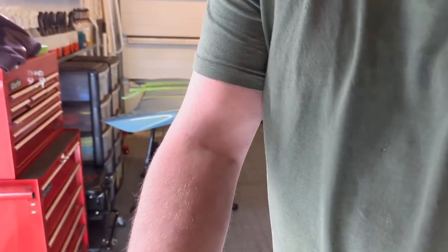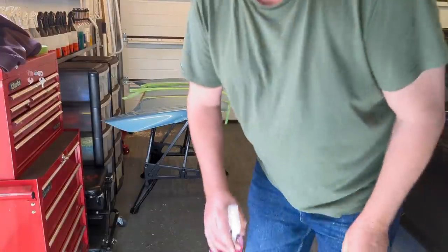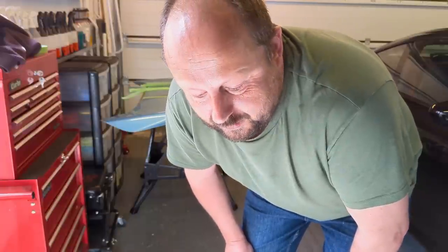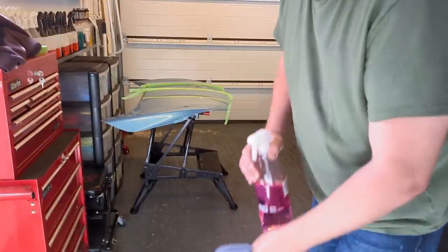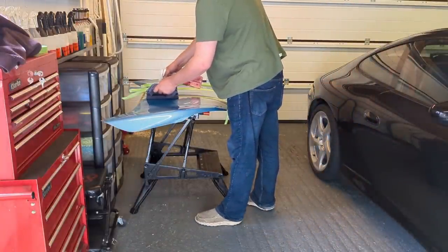The surfactant works and it degreases that, and then you take it out and you wipe it with a cloth and it's really squeaky clean. So you take it out, wipe it with the cloth, then panel wipe it, then it'd be really squeaky clean. So you get the idea. It makes sense in my head that this wash with hot water and dish soap, which is free rinsing. Dish soap, we all know it can be used on a car. Some people are like, oh, you mustn't do that. We know it's safe. It's just probably not as effective or suitable as a good car shampoo. And it's not as cheap as a good car shampoo. Well, not the ones I recommend. So this isn't about dish soap so much. So let's just panel wipe this section.